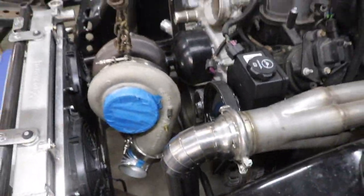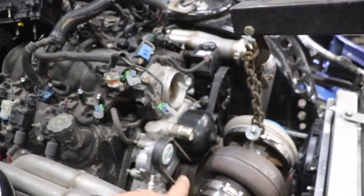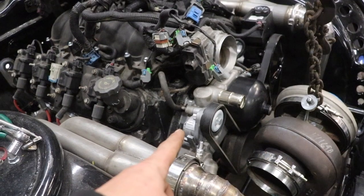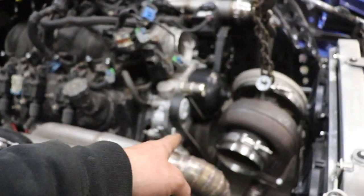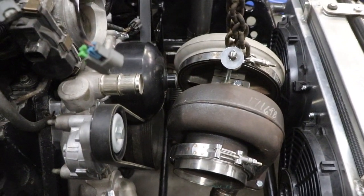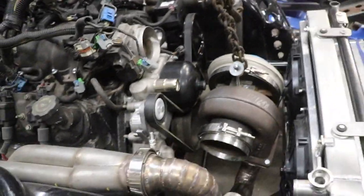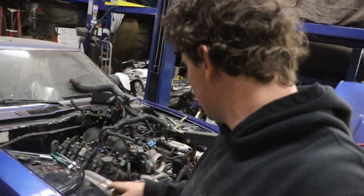It clears the water pump too. We could get more room because this setup has the truck spacing with the LS1 water pump to clear the LS1 throttle body. With the right combination, we could get rid of those spacers, get a different crank pulley, and move everything back to create more room. Right now we've got about half an inch of clearance which is fine. I'm going to pull this turbo off now and start fully welding up the driver's side.